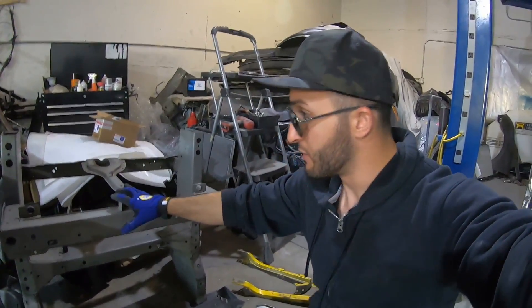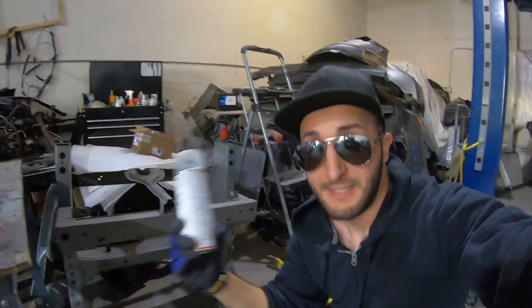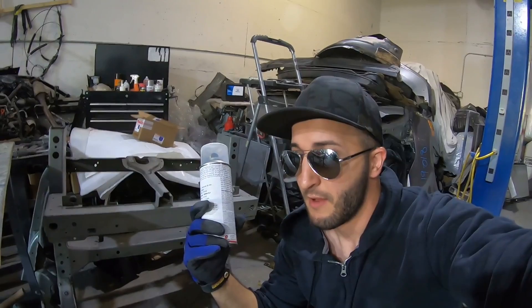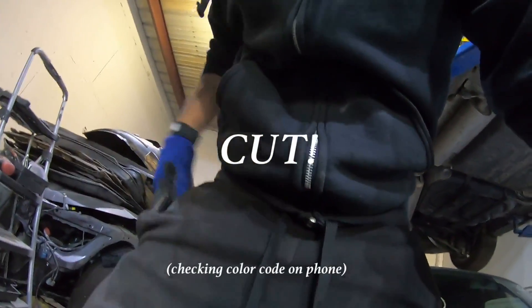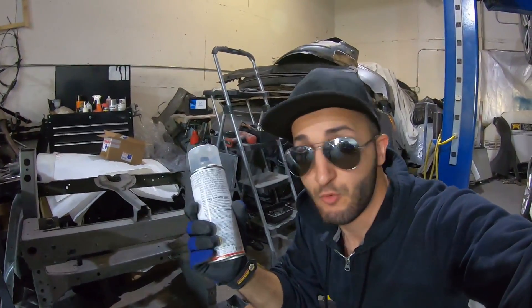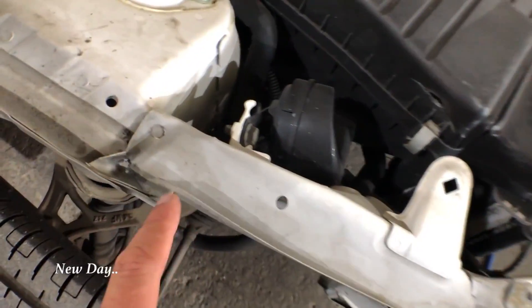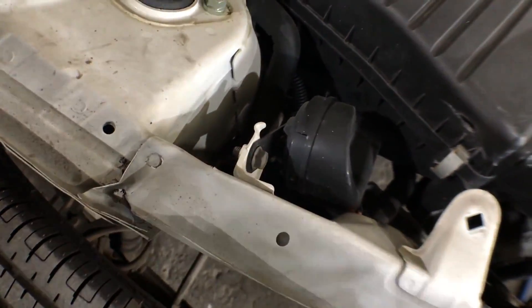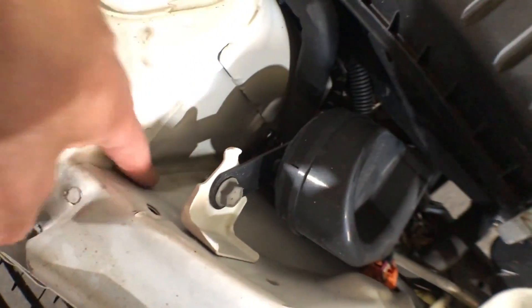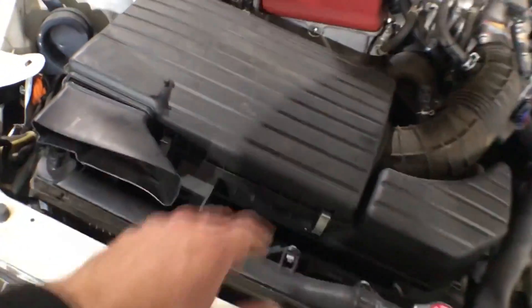So we got the front radiator support right here that we just cut — got the top portion, lower portion, everything's here. I did get some paint: Grand Prix white, NH565. It's just a flat white, beautiful white in my opinion. I do want to point out a couple of things — first, this rip in the support. The good thing is it is on the support after the strut tower and it does drill off nicely. This lower side right here also has some damage. Going to go ahead and strip the front end — the radiator, the air cleaner, and all that.